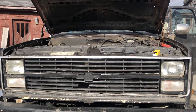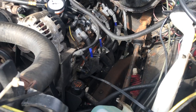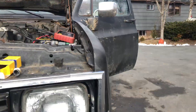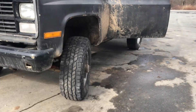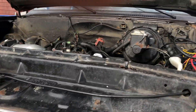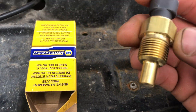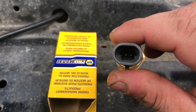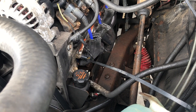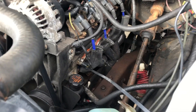Another cold crappy day here in Nova Scotia. We're gonna be diagnosing a P0118 code on this LQ4 swapped six-liter square body. What's been happening is we actually had two things fail at basically the same time — low fuel pressure, so we just put a new pump in. But besides the low fuel pressure, I think this sensor here is causing a lot of my issues. Nappa had one in stock this morning for 21 bucks, so I picked it up. The sensor is right there in the side of the block — pretty easy to change.